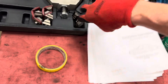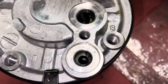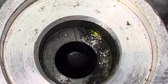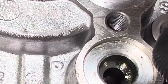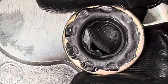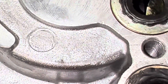What we have here is a complete catastrophic failure. If you look inside the discharge hole, you can see gunk in there — you can tell how hot it got. The seal literally melted. Right there, that is a seal from the gasket — that was a brand new gasket that was in there and this is what happened to it.